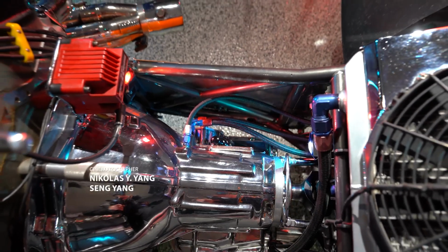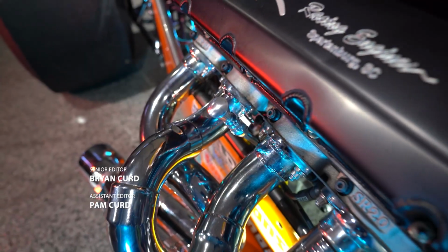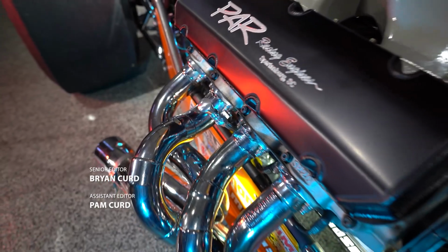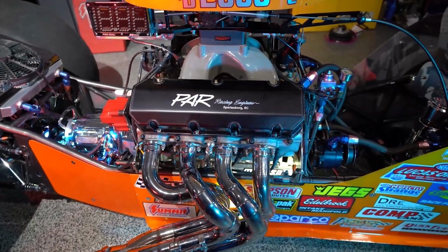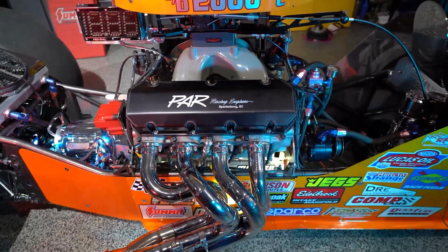Back in 2005, I made a B16 1.6 liter Honda Civic with a turbo, 28 pounds of boost on the dyno. The oil dipstick shot out of the crankcase, hit the wall, and oil went everywhere. That's pressure. You want to keep the dipstick in because of the pressure. And the second reason is you have a rollover. The fluids will stay in the components because the locking dipstick is not going to fall out, right?